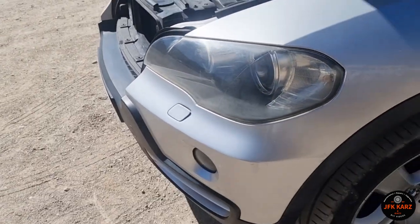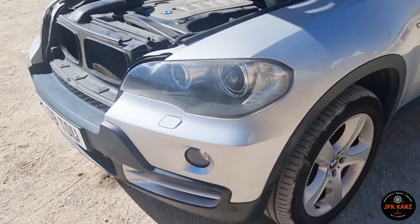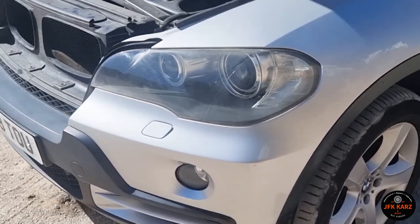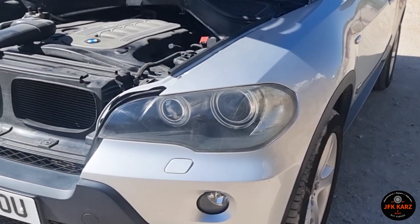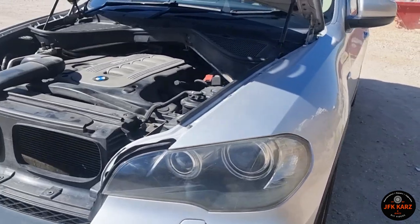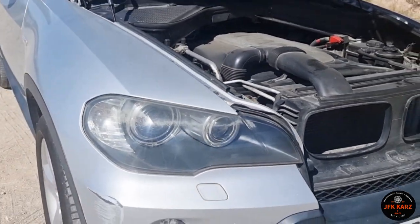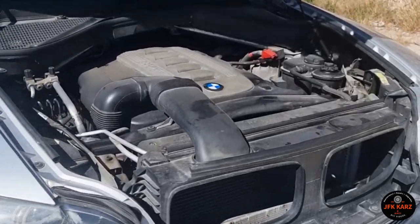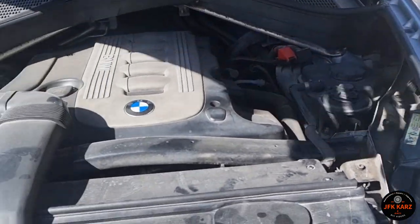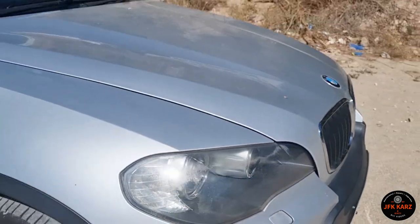Because I'm in Spain, this headlight is going to be the one that just needs to be dropped a few degrees below horizontal. It is a vertical beam with the Xenon headlights. I know it works because I've done it on an E93 as well, which has just been matriculated onto Spanish plates. So we're going to go into the garage and adjust the headlight beam.